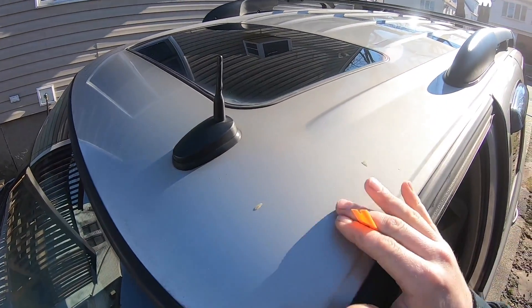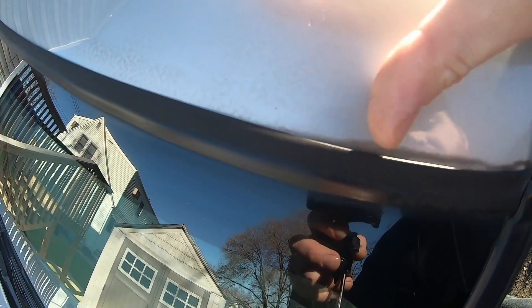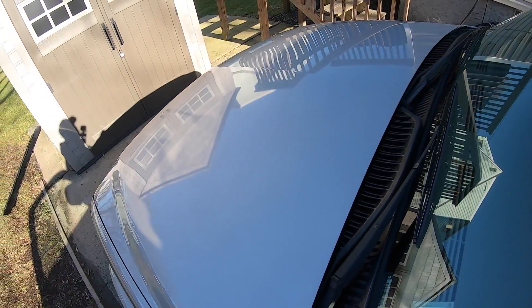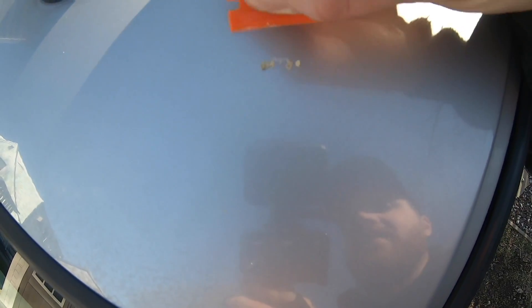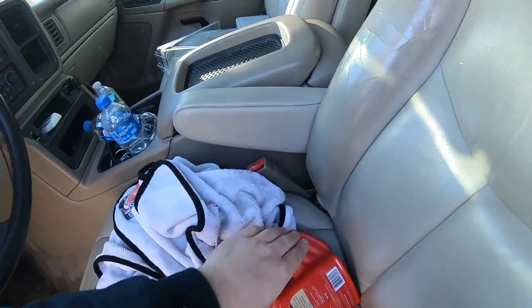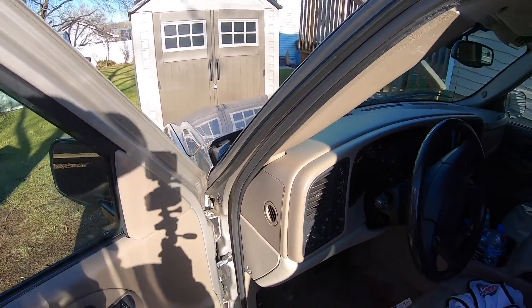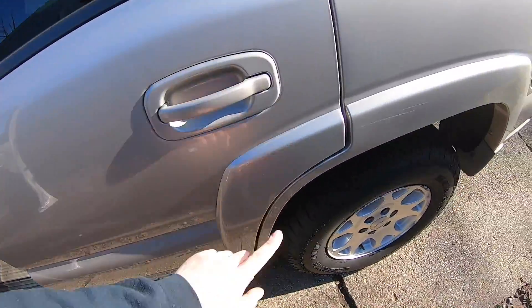Only thing I noticed is there's some crap up here on the roof — just like dirt staining. This little shadowing over here as well as over there was coming off the clay bar. I think I'm just going to hit it with the buffer and the rest of this should come off. I have the same kind of staining down there where the bug deflector was. Over here there's some dried sap — I have a little plastic razor blade and that just scrapes off really nicely without damaging the paint. As for this synthetic clay bar, I got to say it did a great job. Let's grab the DA, hit the roof, and then start going around the body trying to get some of these scuffs and scrapes out.